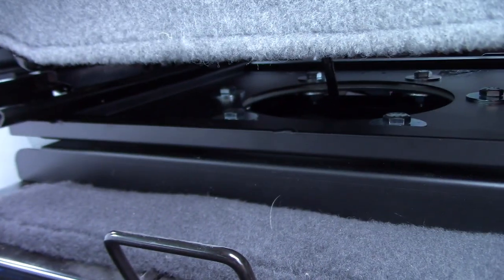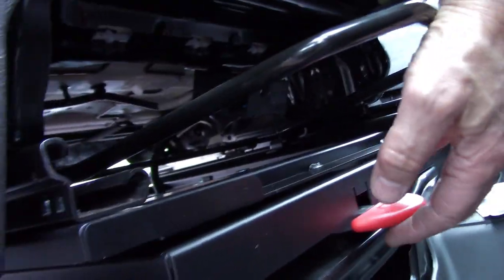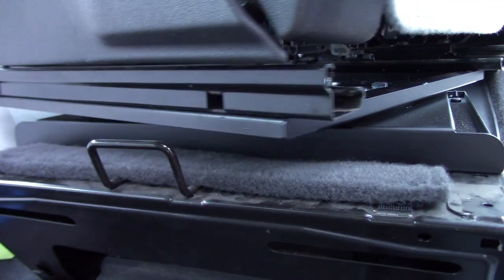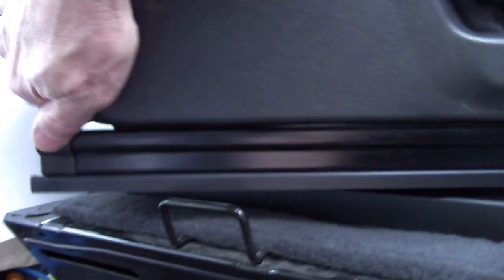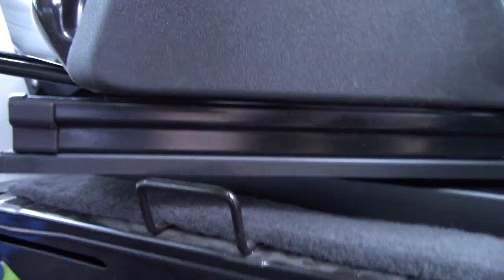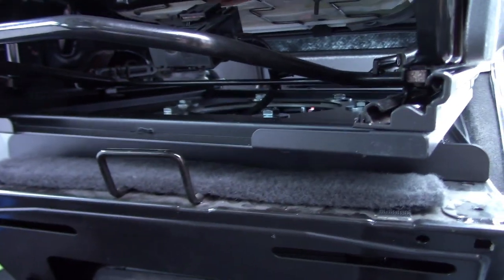Now in a Ford Transit this may be in your way. The seat swivel does raise the height off the base a bit, but the way it swivels when you actuate it, the swivel base on the upper part may hit this metal bar — maybe not the first click but the second one for sure as you swivel the seat all the way around. You need to remove it so that it can clear and doesn't scrape.